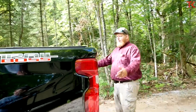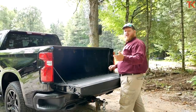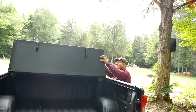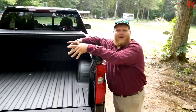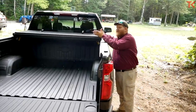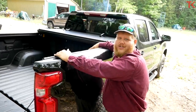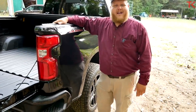Getting to the very back, we have the tailgate which is push button open and it is damped — always a nice feature. Our truck has a tri-fold hard tonneau cover: click a little latch and boom, one two three it folds up. I love how solid it is and when closed it really gives you a trunk-like feel back here. The issue is once it's folded out of the way it's still eating up the first three feet of your bed, so if you need something tall you've got to keep that in mind.